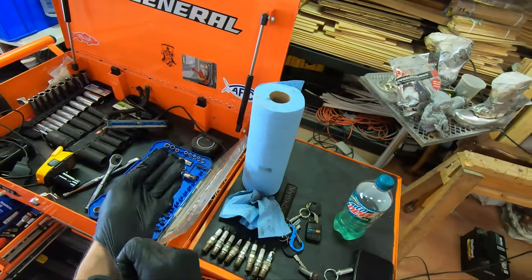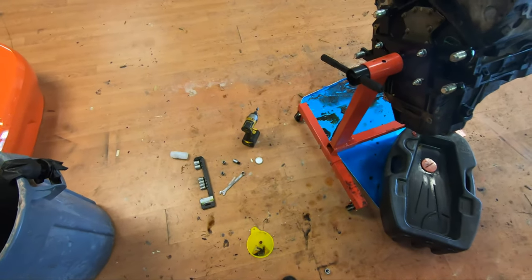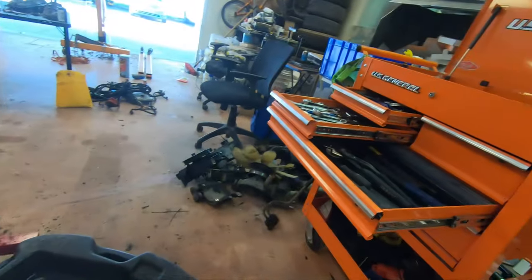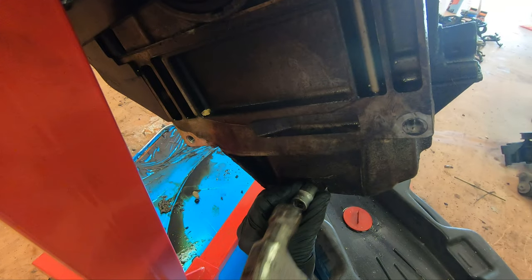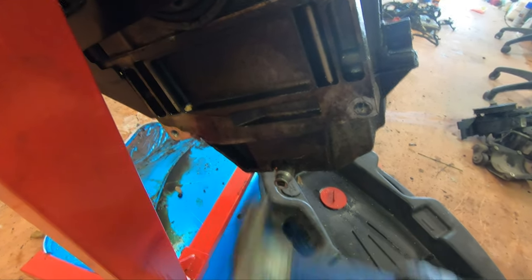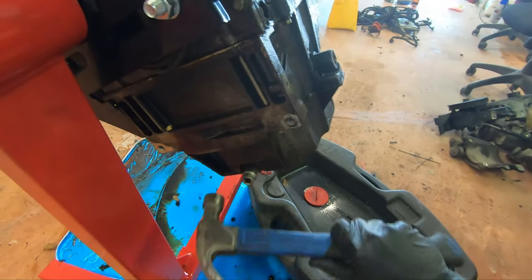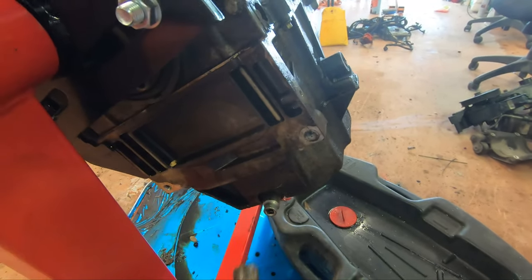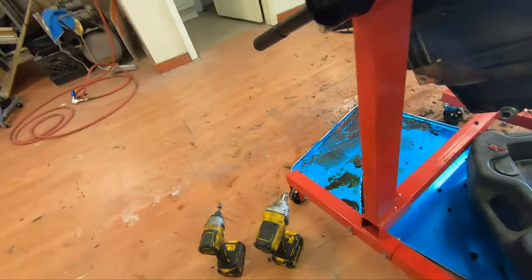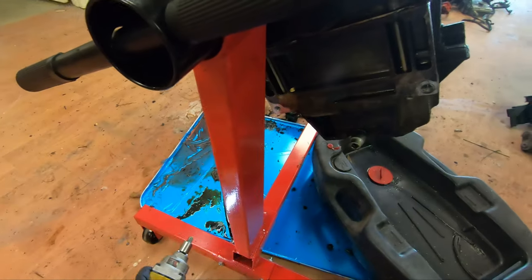But the important thing is, I needed that stripping socket because this is the same size bolt as that bolt. Basically, what you do is you hammer them on. So I'm gonna grab my hammer and strip that out, and again, of course I won't be reusing this. Hammer it on real nice and snug. And of course, it looks pretty on, could use a little bit more. I will turn that down. Then, you take this. Ta-da! Now it's coming off.